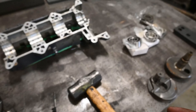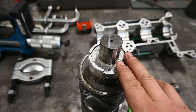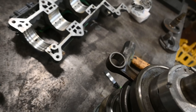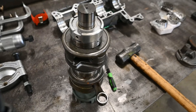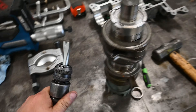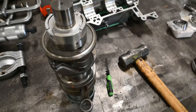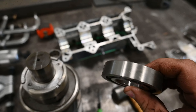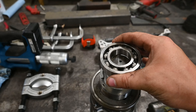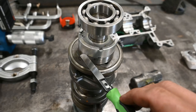We're about a week later now. I got the new bearings and got that bearing off. I didn't film it because I didn't really know what I was doing - I was trying to get it off without having to take the whole stack off. What I found was with an air hammer with this little goofy bit, if I get inside one of those holes I could pop it off far enough to get my puller on it and pull the bearing off. Now I'm going to put the new bearing on - I need to find this hole, make sure it goes towards the spacer. I'm going to heat this bearing up a little bit, set it on there, and use a feeler gauge to keep the bearing off the spacer so the spacer can still turn freely.